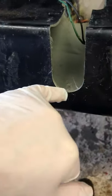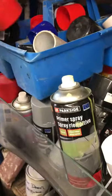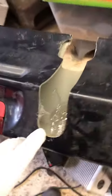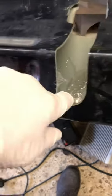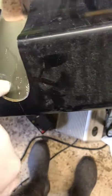I thought first of all I could put fiberglass on the inside, soak it in resin. Little tip: if you're doing small jobs like this and you want a handy cup, collect the caps from spray cans — very useful as cups to mix things and then discard. I did try the fiberglass strips soaked in resin and hardener across here, but for some reason it didn't seem to set properly, so I cleaned it up and got those out.